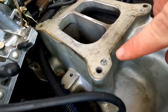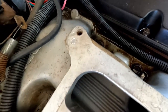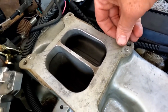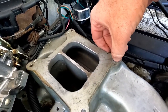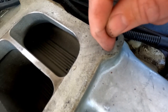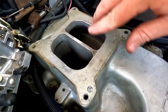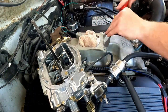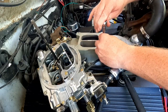One thing I just noticed after taking that adapter off is that it was tightened down in a way that it was bottoming into the intake. You can see every corner has got some issues and there's some metal shavings there. I'm going to get that cleaned up — hopefully that doesn't cause an issue. I'm going to run my gasket scraper over this and make sure it's cleaned off as much as possible because that could also be causing an issue. Basically it looks like when they over-tightened this, it pushed the aluminum up around the edge of that hole — there's a lip all the way around this hole. I'm hoping I can knock that down on all four sides and flatten this out, and then I'll put the studs in the intake.